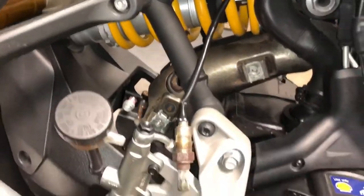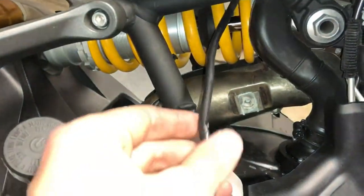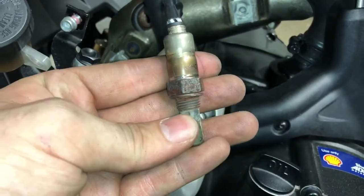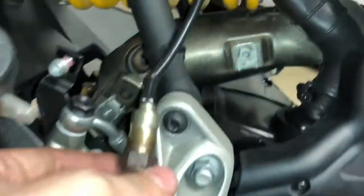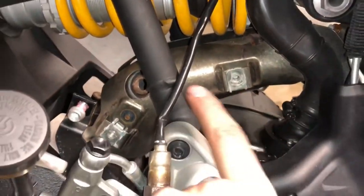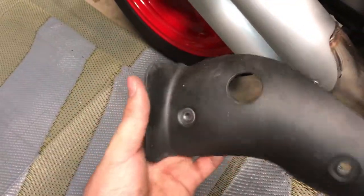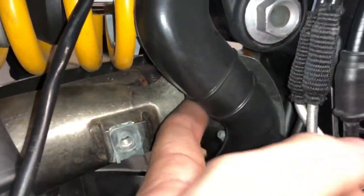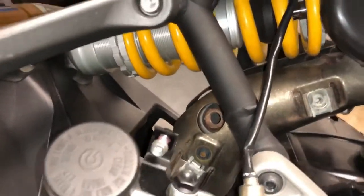I went ahead and removed that O2 sensor — it does get kind of tangled and twisted around while you're removing it, but you only have to go that many threads so you probably won't damage it. The next thing I did was slide that heat shield off — it's kind of like the other one with that little L bracket. This little indentation here is for the oil vent tube — it fits up behind that — so just squeeze it towards you with your finger and it should slide right out.